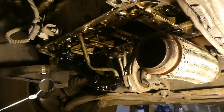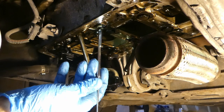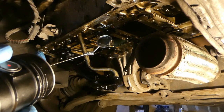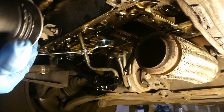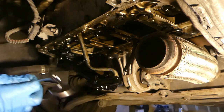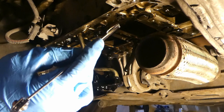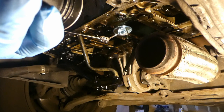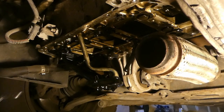One last thing I forgot to say: it's actually a very good idea - now is the time to check if the different channels, gullies and so on in the engine are pretty clean. You don't want to be underneath with oil dripping, but if you have a mirror you can actually look inside there. You can see whether they're clean, whether there's any sludge in the actual hoses. You can go around and inspect every single one of these gullies. These are pretty clean actually - there's basically just oil rather than any sludge. So next thing is to clean all these surfaces - now cleaning.